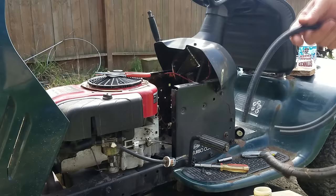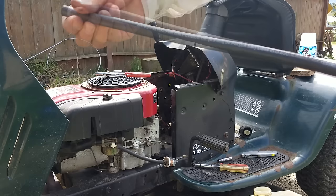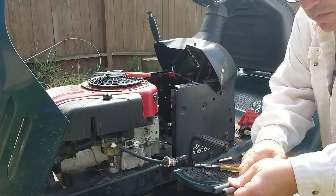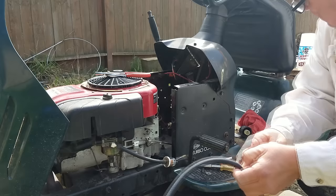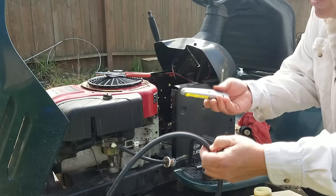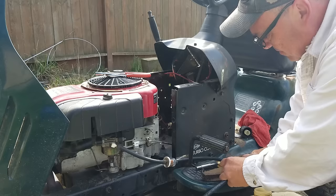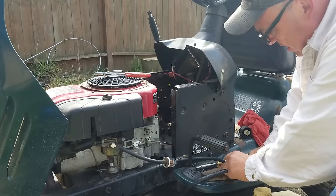What I did is I went to O'Reilly's and bought some Gates fuel line — I like the Gates stuff a lot. It's quarter inch, which is what these lawnmowers use. So we're going to match the new fuel line up to the old one, cut it off approximately here. I'm going to take a wooden block, set it down here, and use a razor knife. Don't cut fuel lines or any hoses with dikes or side cutters — just make a nice clean cut on a piece of wood so you don't scratch anything or break your blade.